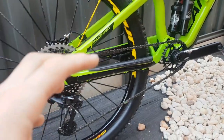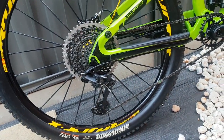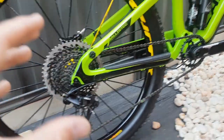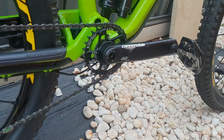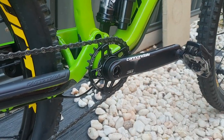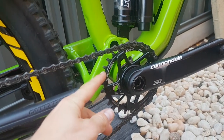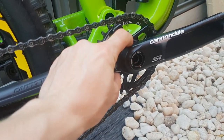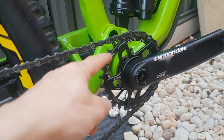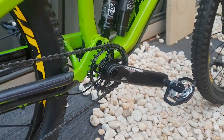It was making a really bad rough grinding noise and I thought it would have just been the gears, so I adjusted them over and over again and it still kept doing it. Gut feeling told me I needed a new chainring. I looked at a whole new SRAM crankset but that was going to be pretty expensive. So instead, I bought a Wolftooth spider specifically for the Cannondale and then got the chainring for it — a 28 tooth front chainring — which in combination with the 50 tooth cassette on the back and clip-in pedals, this thing will just monster up anything.